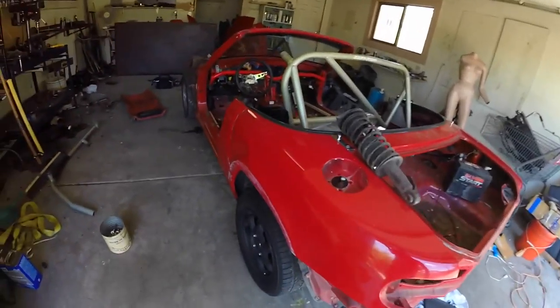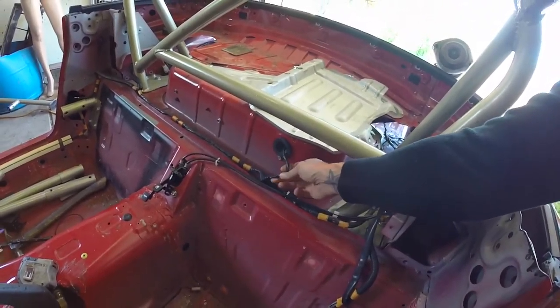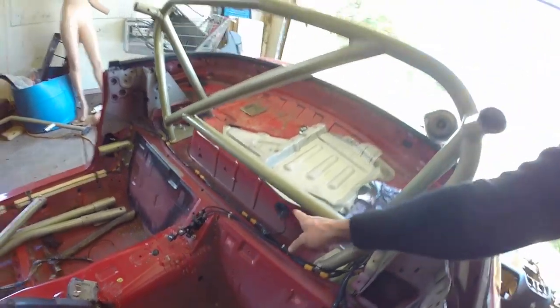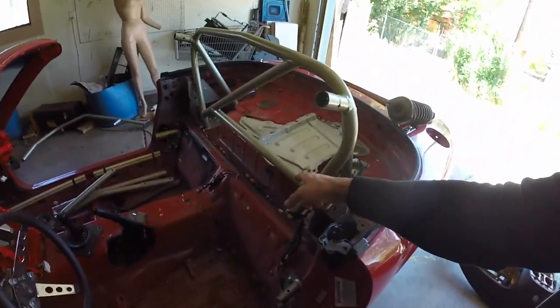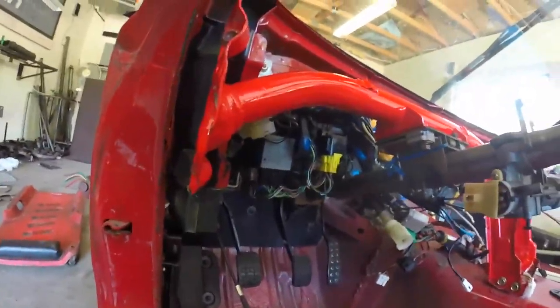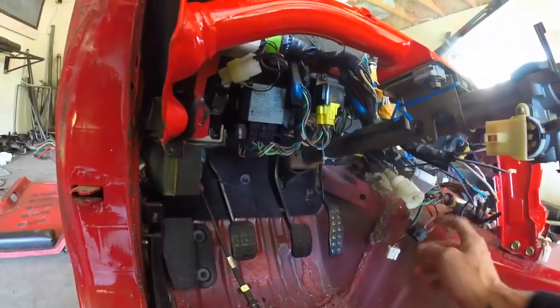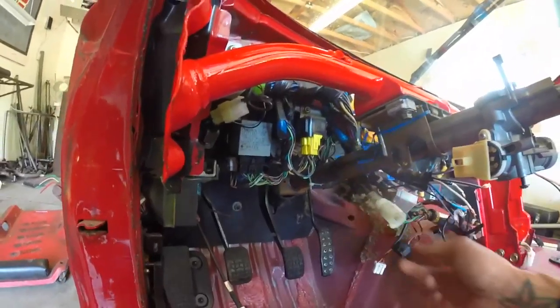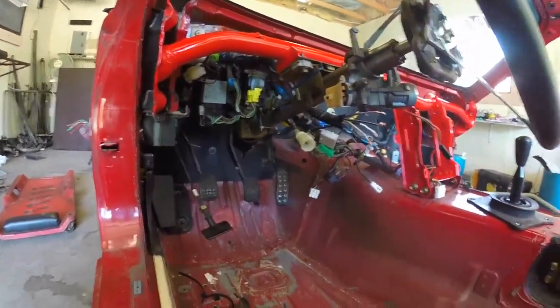I think I've narrowed it down. A lot of online people are saying that the 1.6 has an issue with this wire harness going into the fuel pump because I do not hear the fuel pump cutting on. I'm assuming it could be that. It also could be a fuel pump relay that exists right around here somewhere. There also is the possibility that one of the grounds that are not connected for the wire harness needs to be connected. So I need to connect all the grounds back to where they're supposed to go.